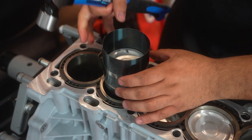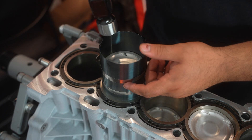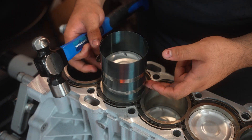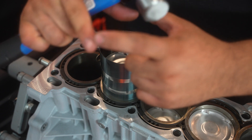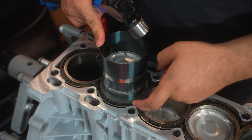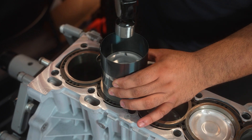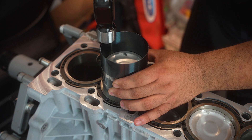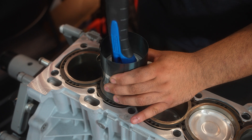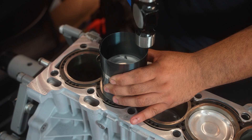When you're using a ring compressor to install the piston, it's extremely important to tap on the outer rim so you make sure it's properly seated around the cylinder. That way, when the piston comes down it won't get stuck on the outside and chip the rings, because they are extremely fragile. Even though it's an easy step, take your time — slight taps all around, double-check it's seated properly, and then with the butt of the hammer slightly tap it in, checking the seating every couple of taps.